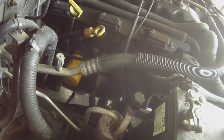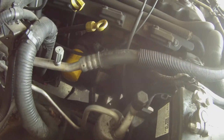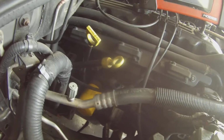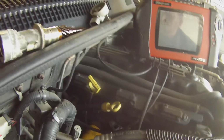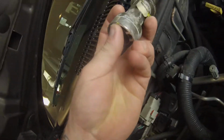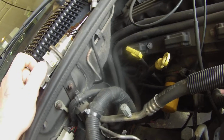Now a lot of guys, they go ahead and replace the crank sensor when they get that code, and that code actually refers to the crank and the cam sensor. So if you have this problem, you know, check out your distributor. You'll usually notice the noise. Like I said, I've done multiple of these. Same thing with phantom misfires. You can't figure out a phantom misfire.